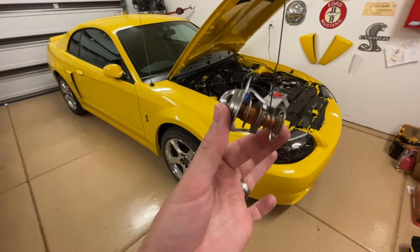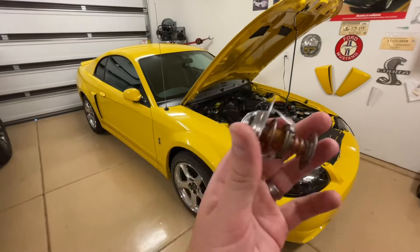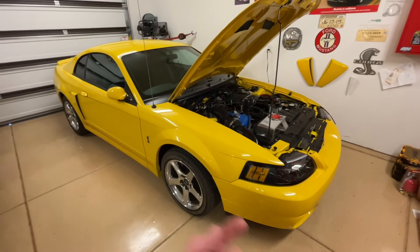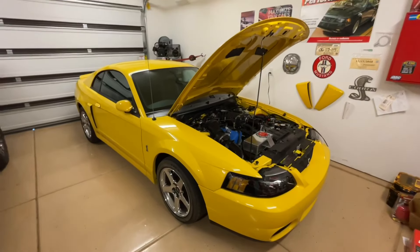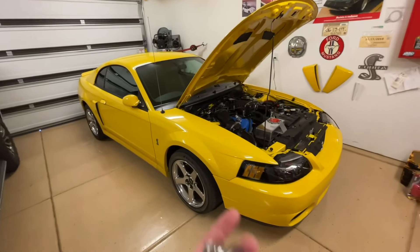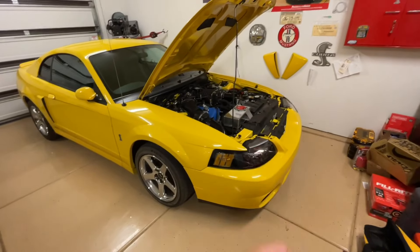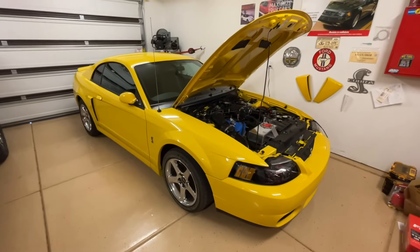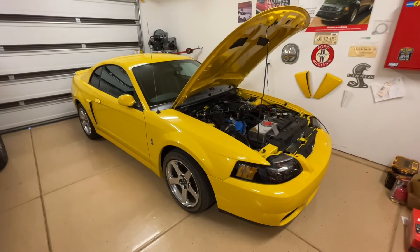It's something people always think — I'm going to just take this out and the car is going to run cooler and the engine won't heat up as much. That's not always the case, so just make sure you know about that before you do it. You can actually cause the car to overheat by removing the thermostat, as the air doesn't have time to cool off the coolant as it goes through the radiator. Thanks for watching — let me know in the comments what you think. If you're new to the channel, please subscribe. As always, thanks for watching.